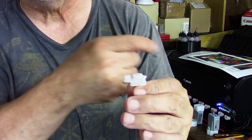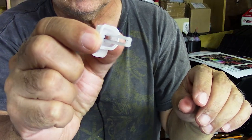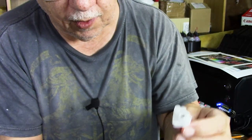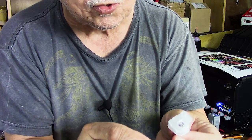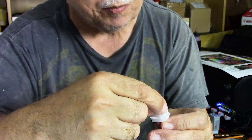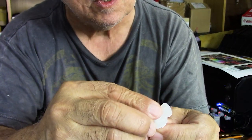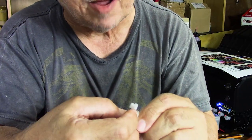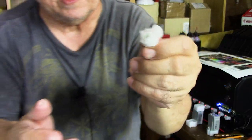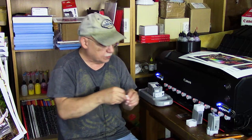Once you remove the valve, this is what you have. All it is is this compartment — it holds a spring, here's the spring — and the poppet valve simply looks like this. It's so small as to be almost imperceptible. You pop it inside the spring like so, and then you insert this o-ring. That's all it is, folks. That is all that's holding that poppet valve in place. There you go — that is your valve. Nothing really intricate. That's the only mechanical component that exists inside the cartridge.